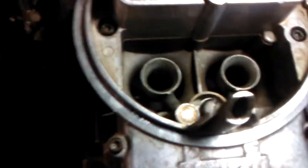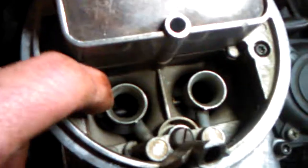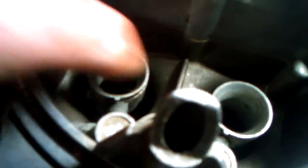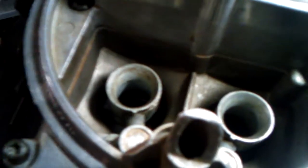The main difference is that this booster acts more like a shower head — it dispenses a lot of tiny, atomized drops of fuel. There are eight small annuluses, or holes, that dispense fuel into the engine — not in big blobs, but in tiny small droplets.